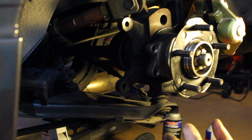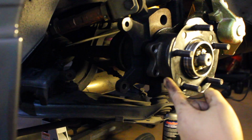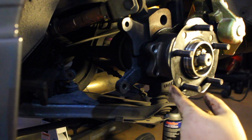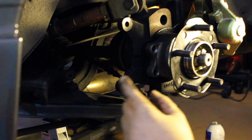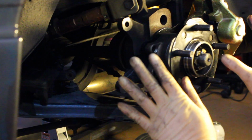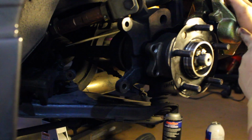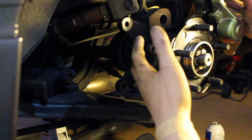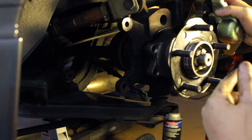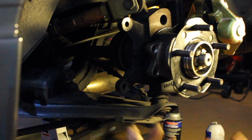So my main plan is to replace the rear caliper. We will keep the soft line because the soft line is still good. Basically, we just don't want to leak, obviously. So I have everything removed. If you have the rear Wilwood kit, obviously just go through the directions on how to remove the rotor, because it's a funky way of putting it on based on how Wilwood has it set up. But if you don't have it, just take everything off as if you're doing a brake job.